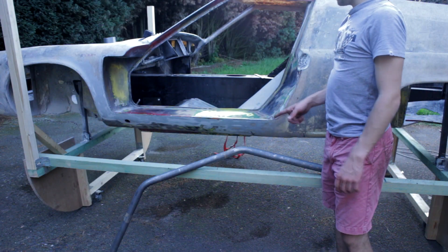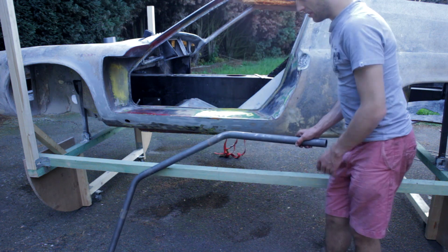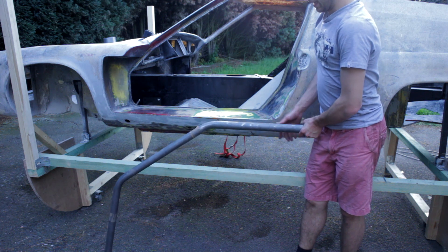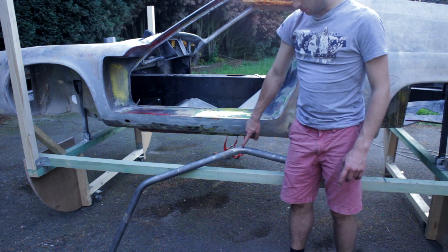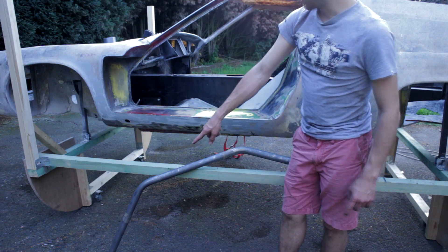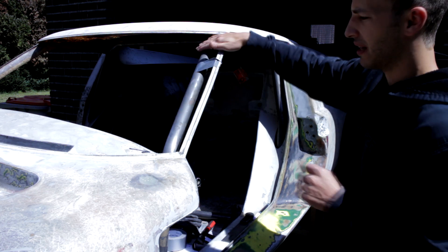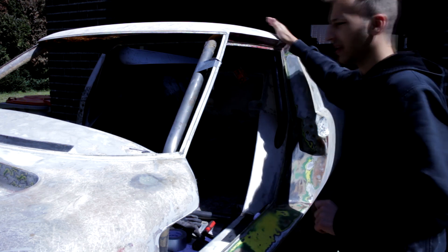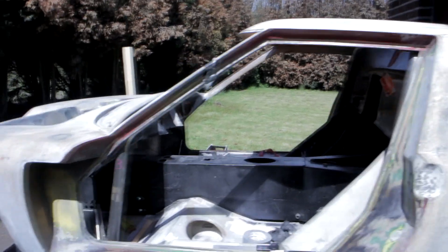You can see how well the outrigger fits up to the sill bar. The front half laterals are a bit more difficult because they have two bends with a rotation between them, so they're in two different planes — they go in at roof level. We need to make sure we have them the correct way up. We can check this because one bend is 145 degrees and the other is 135 degrees. The front half lateral is completely parallel with the A-pillar, joining at the roof and at the bottom at the sill bar. When viewed from the side it's completely hidden by the profile of the roof and the A-pillar.